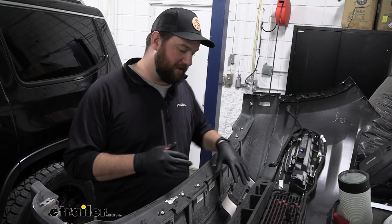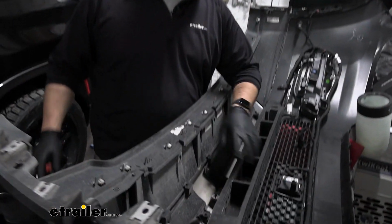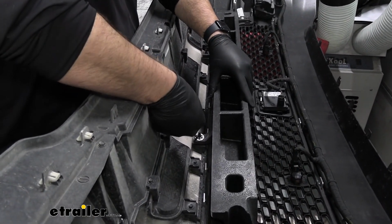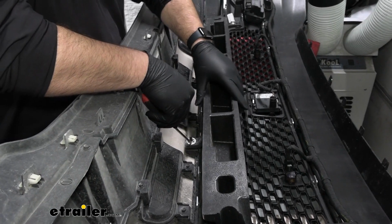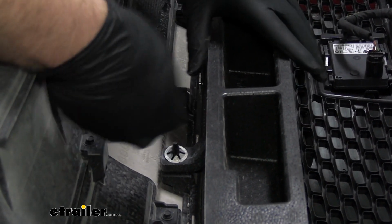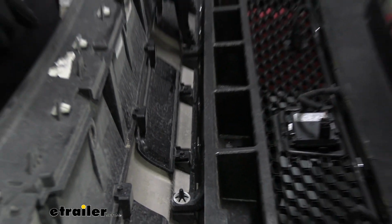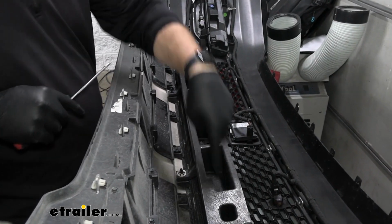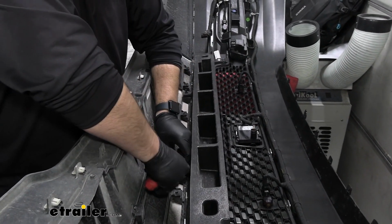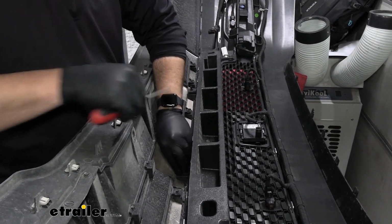Now turning back to our fascia, getting it ready to go back on the vehicle, we have 5 of these star washers that we need to remove because we're going to be removing this vibration panel and it will not be put back on the vehicle. You'll have one here, one at the end, one in the middle, and one on the other end. You kind of just bend those tabs up with a screwdriver to get it pulled off.